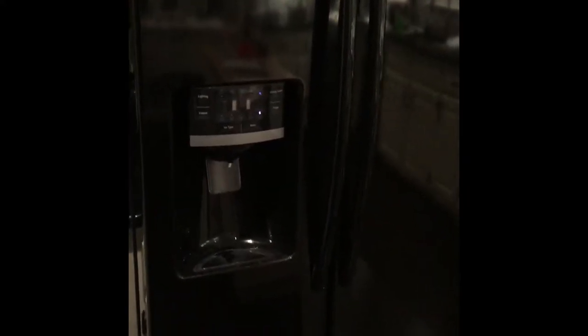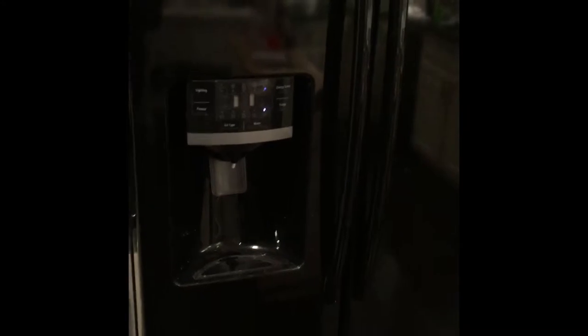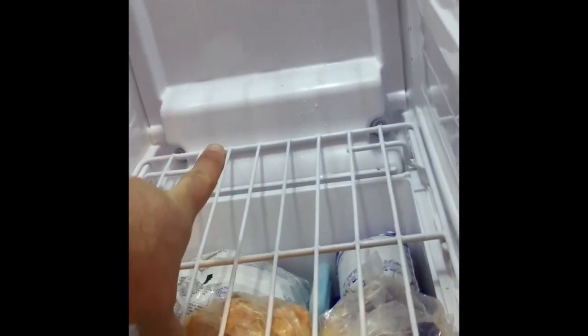This is the Samsung side-by-side refrigerator we have — this is the one with the freezing problem where water ends up on the floor right there. I've determined this is from the defrost drain right here behind this panel. There are six screws: two here, two there, and then two more under clips. Take all that out and the coils will be exposed.